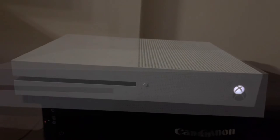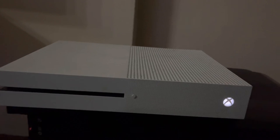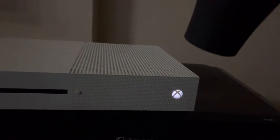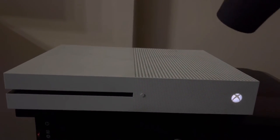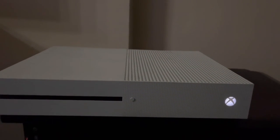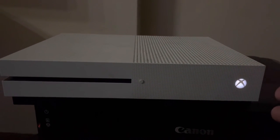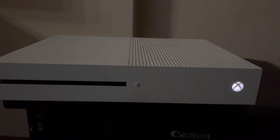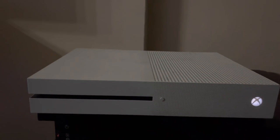Alright guys, so the first time around didn't work. What I did again — I just took the same blower and for another minute or so blew on top to make sure all the dust that's in there, maybe clogging the fan, is out. I tried again and here it is — it's coming on, you can see the button. So it's on now, and hopefully that will solve your problem as well. Thank you for watching, see you next time.